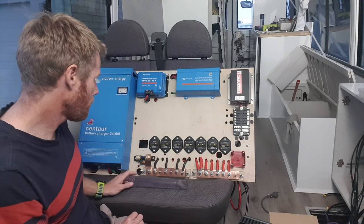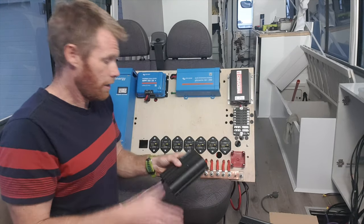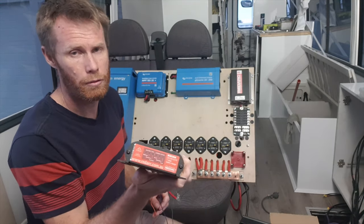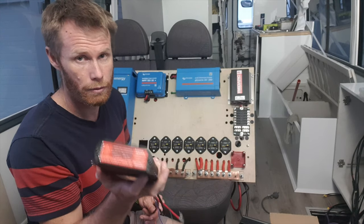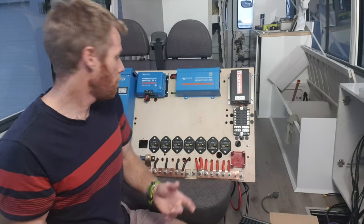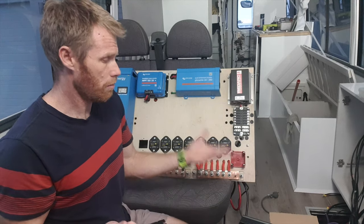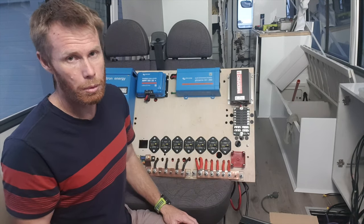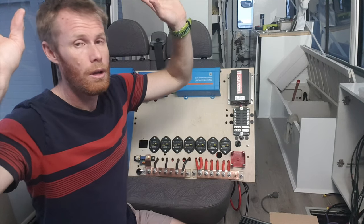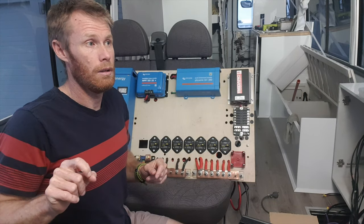As I said, circuit breakers for everything. I ran out of room to put this — it's the RedArc BCDC, 24 volt, 20 amp charger. That will run from the alternator to charge up my auxiliary and starter batteries once all connected. At a later stage I'm just going to buy one of Off-Road Living's solar charge controllers to put somewhere underneath where the batteries are, to connect to a portable solar panel in case there's minimal light hitting the panels up on the roof, which are two 300 watt panels connected in series.